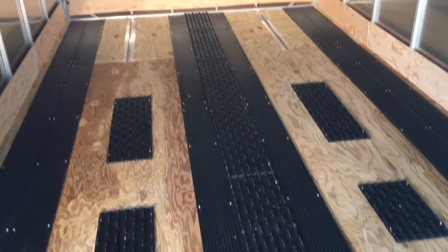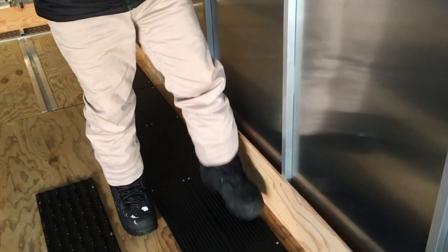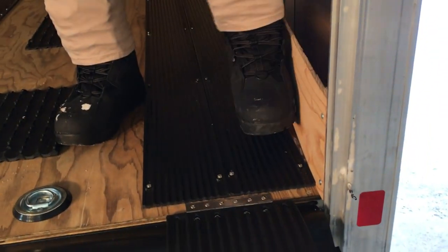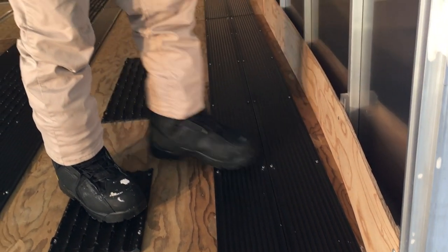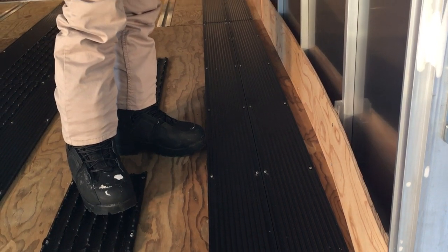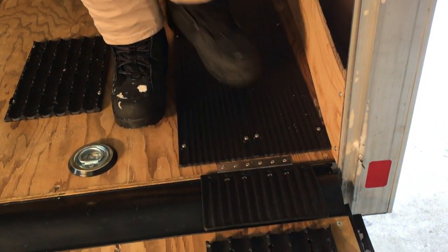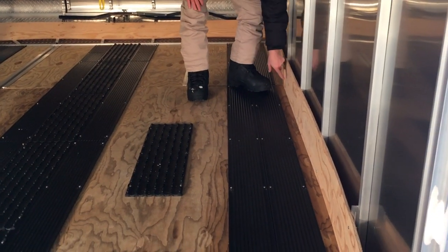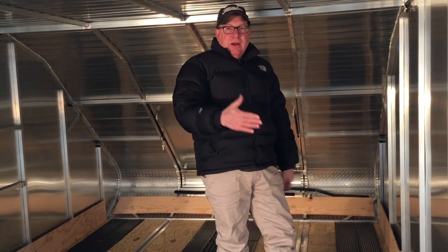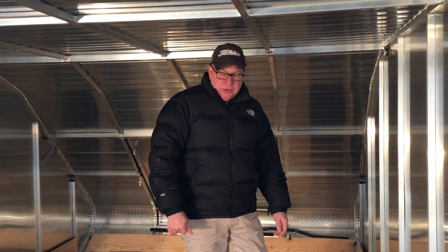The Triton has a nice feature where they've angled the edge of the ski slide so that when you load and unload you're not going to catch a ski on the side of the trailer. What that does is kick this area out by about two inches, and you'll see a lot of guys install their glides up along the edge at different angles. We opted instead to start our glide at the point where it's two inches out, which allowed us to run the glides straight up to the front with a two-inch gap on the sides. That two-inch gap is not going to affect the ability to get the sled in and out or get the carbides in the right position, given the skis we're using and the width — this will work and fit just fine.